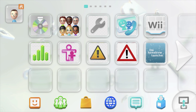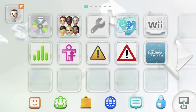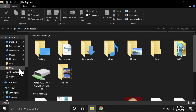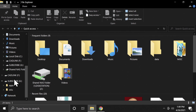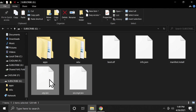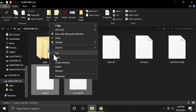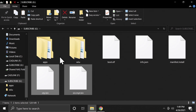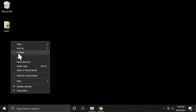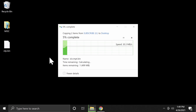Go ahead and power off your Wii U, remove the SD card, and put it back in your computer so we can retrieve the backup files. With the SD card back in your computer, open File Explorer and navigate to your SD card. You're looking for two particular files: SLCC MPT and OTP. If you selected optional backups during the NAND Dumper process, you may have other binary files as well. Copy all those binary files and paste them somewhere on your PC — a desktop or any folder of your choice.